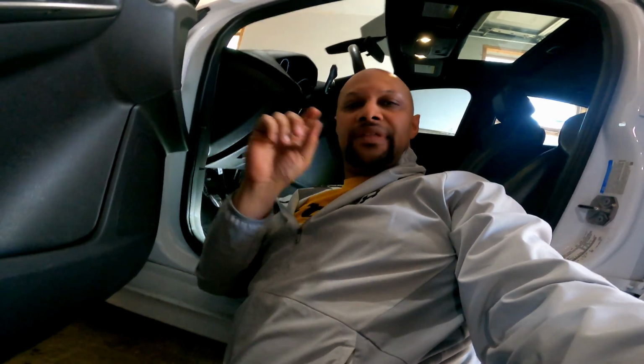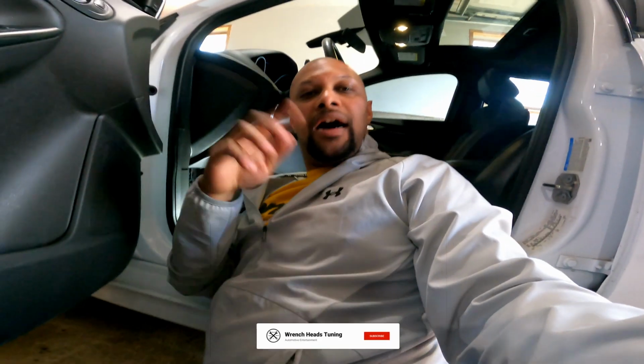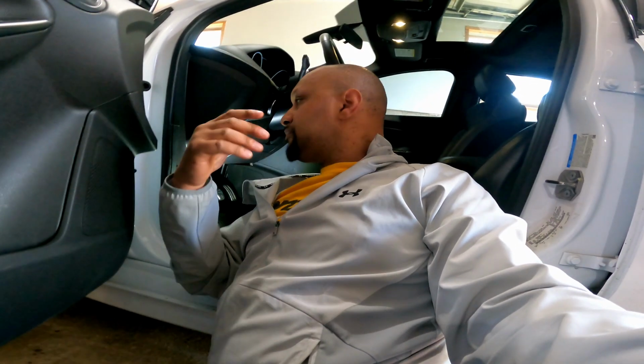So essentially, instead of that little hop coming up, you have a very minor hop going towards the floor, which I think is more typical of what you see on either a stage 1 performance clutch or an OEM clutch, where the spring has more of that pop or hop feeling as you're getting close to bottoming it out, versus when you're releasing it. So this is going to be a much, much better feel.